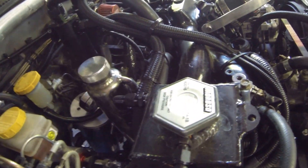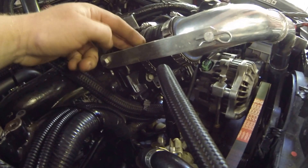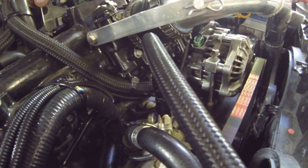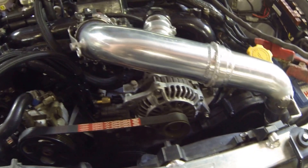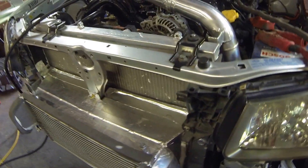All the intercooler piping — there's a blow-off valve, the TurboSmart. I'll put these straps on any coupling to hopefully hold it against the pressure so it doesn't get blow-offs. In order to do the reverse manifold, I've had to relocate the alternator. There's custom bracketry and adjusters that I've made up myself just to shift it over. Obviously no air conditioning, so that's where it goes. The intercooler is ducted; I'm hoping this is going to help with stopping the air getting around it — I might have to pull it off if it doesn't work.